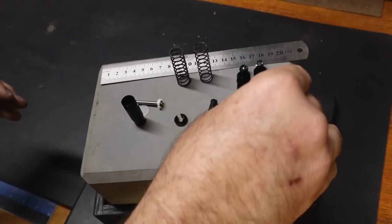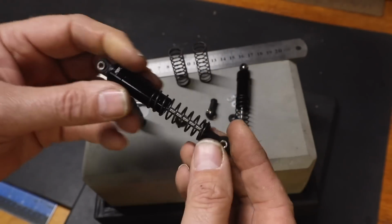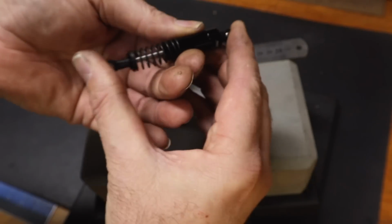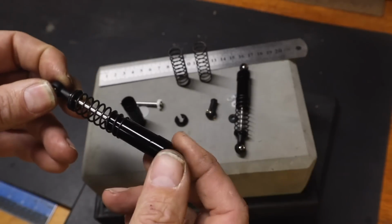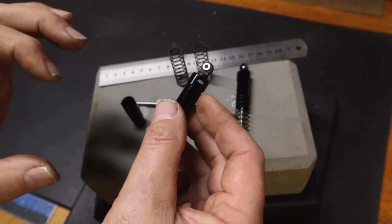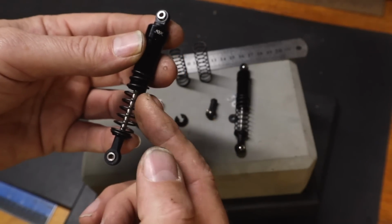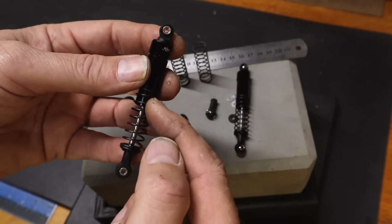So, what I did was I said to myself, this is not tenable, unless maybe you want to use them for a cantilever. We have found a shock, I believe, on the firm spring that could probably be used in a cantilever setup. These are 90 millimeter dead, eye to eye, and that's great. We have a piston that's right about 10 millimeters. The only thing that somebody didn't work out the math on was they're using a pretty typical size seal. Like a desert lizard seal will drop in there.